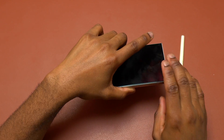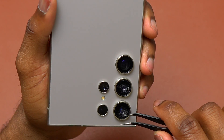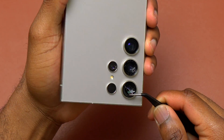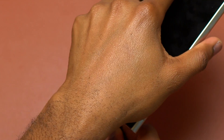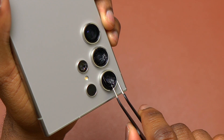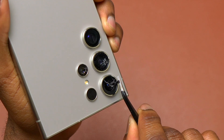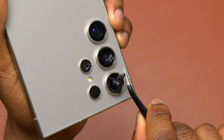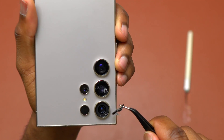It's extremely important: while you're removing the broken camera glass and the tape, make sure that you gently tap on the back of the device for all the broken camera glass to fall on the table, and not on the camera lens or on the inside of your camera bezel. Since there is no heat on the double-sided tape, it is a little bit difficult to remove the tape and broken camera glass in one go — you will have to pull with a little bit more force than usual.